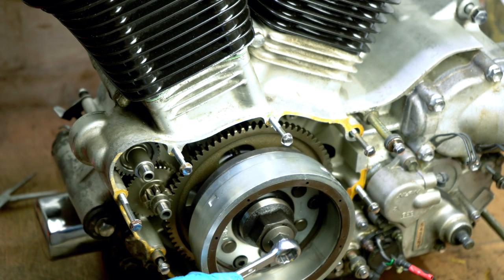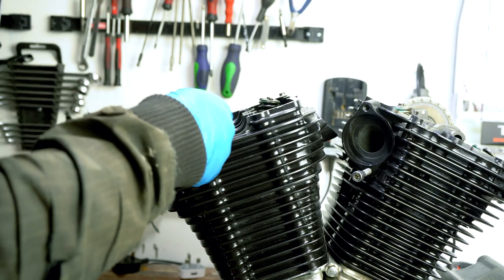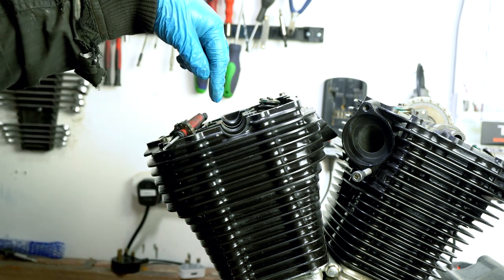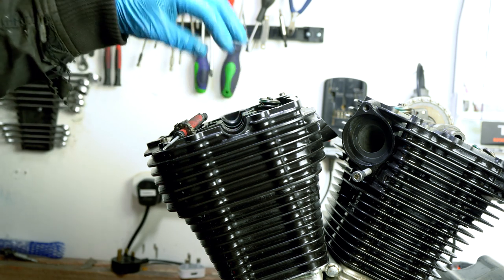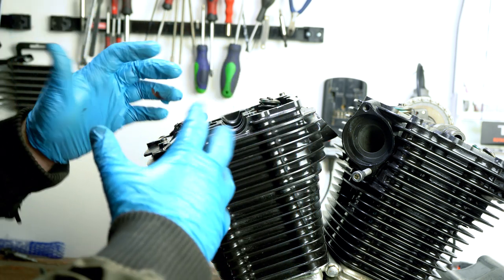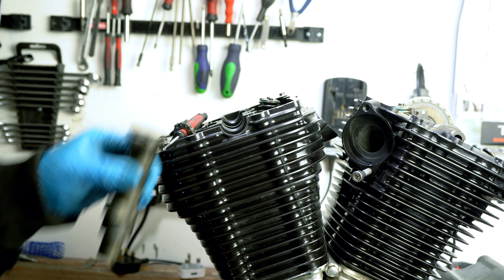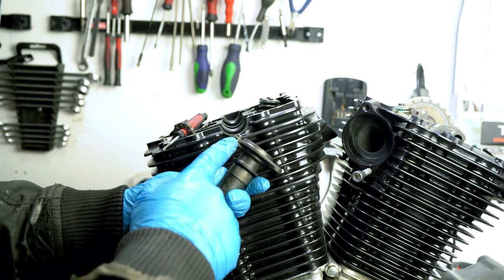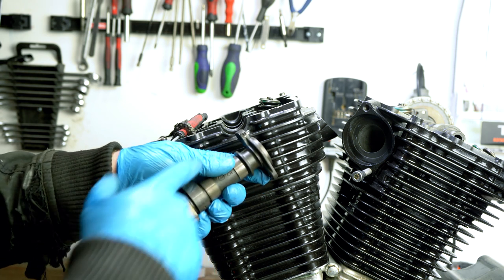Grab a 17mm and very slowly rotate the engine until RT aligns at the top. We need to make sure our chain is out to one side. Remember, we left our stopper in the cam chain tensioner deliberately — it's still in there. I'm actually using an Allen key on the front one — a very small Allen key — but it's keeping the tension off the chain, which is what we need right now. By keeping the tension off the chain, it will allow us to put that chain back onto the sprocket and onto the cam without any restriction. These cams are stamped — F for front, R for rear. The front one is also a little bit shorter than the rear one.